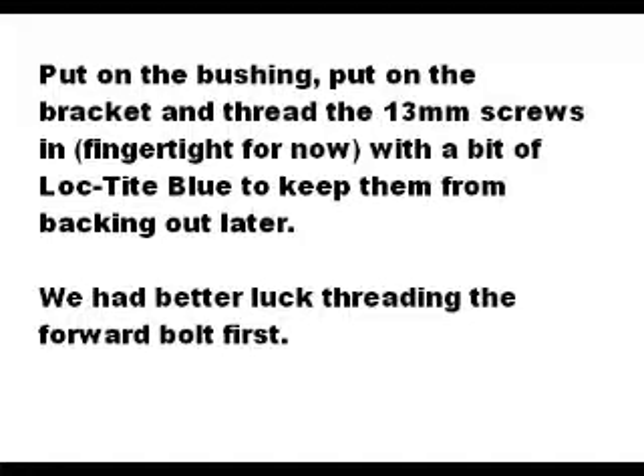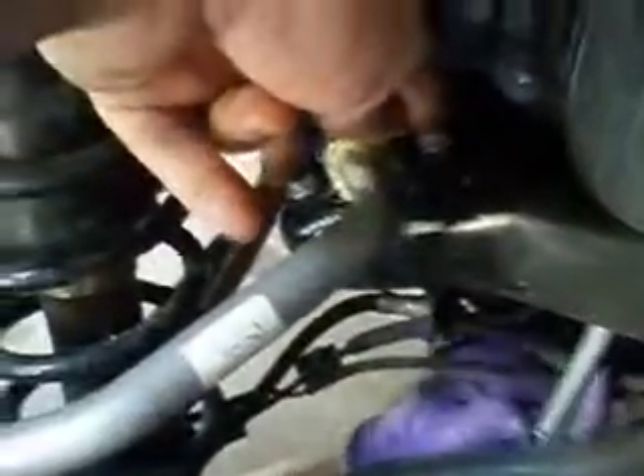It's bright yellow — you can see them there, and they've packed it with grease both on the outside and inside. You want to try and get that bracket back in there. There's a little black bracket that goes up on top of that, and two bolts — 13mm. They go down on top, and those are a pain to get threaded and back on there. As you're putting all these things back together, put the bolt towards the front of the car in first and it'll make your life a little easier.